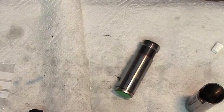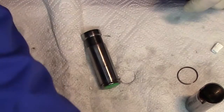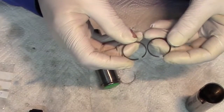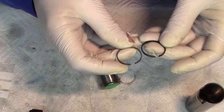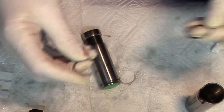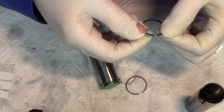The damper is in place and now we go to the sealing ring. It's a rectangular metallic ring. The old one seems to be okay, but I will replace it now. If you squeeze the sealing ring together, it's not a problem, but if you squeeze it apart, it will break.